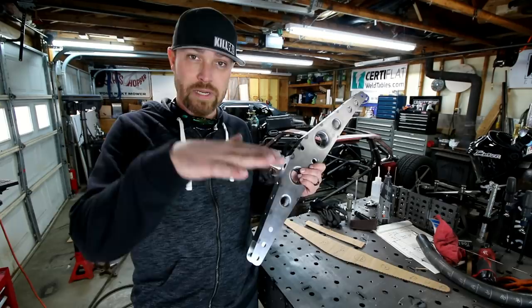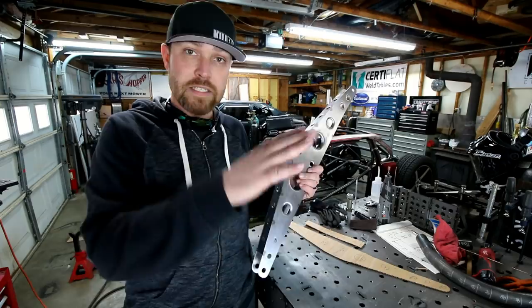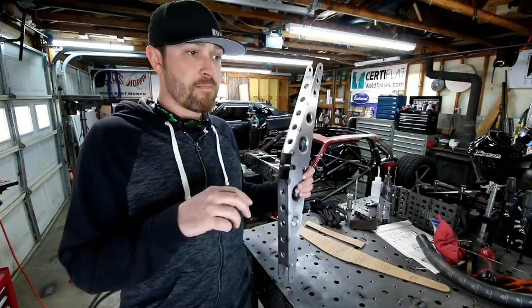And then when it's time to go, kick the pump on, pumps the car up. Probably use some slowdowns there as well, so it's evenly pumped, or as evenly as I possibly can get it, all the way up, full lock on the hydraulic cylinders, and then rock and roll. Drive where you're going, get there, let it down, so on and so forth. Kind of the airbag situation, but instead of airbags, full coilover setup. Hope that makes sense.